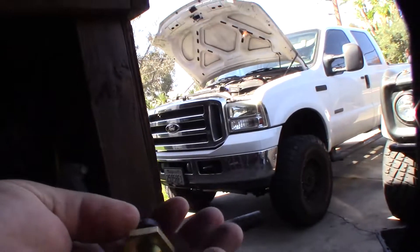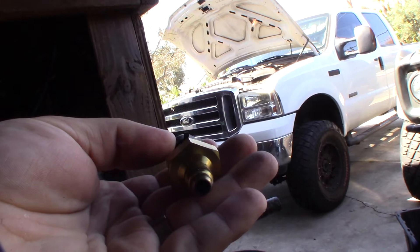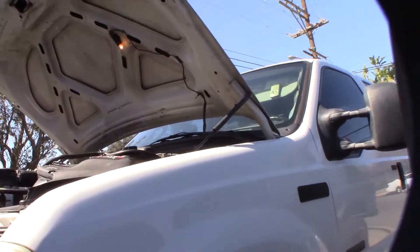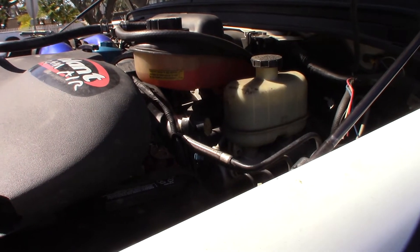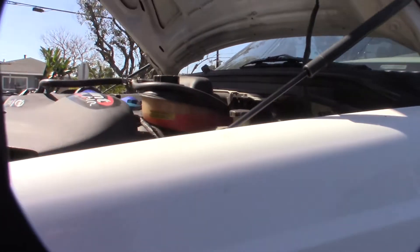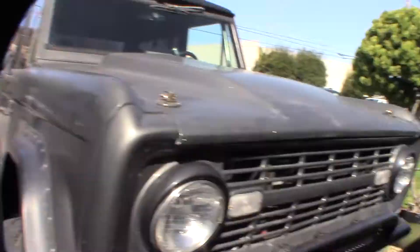This video is just to help out people that are having the idle surge problem. Having a bad sensor — it wasn't even an exact failure, it was just giving me an erroneous reading — but it was causing my turbo backfire and the idle surge. I'm trying to show you my VGT in Torque. I couldn't show you what 85% looked like, but now my idle VGT runs at about 65% to 75%.